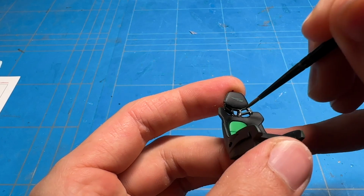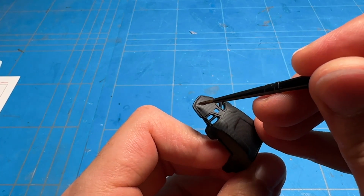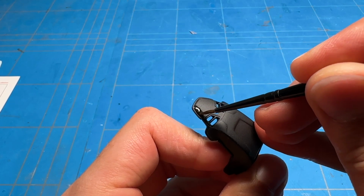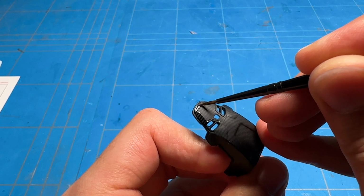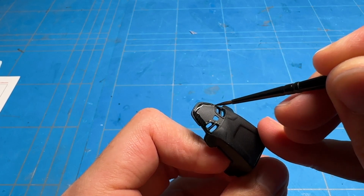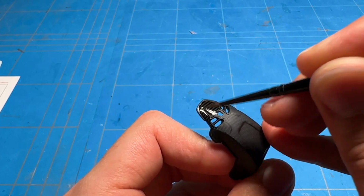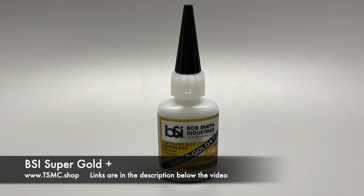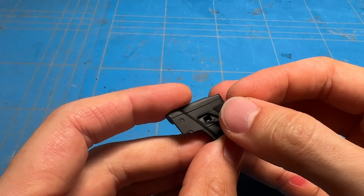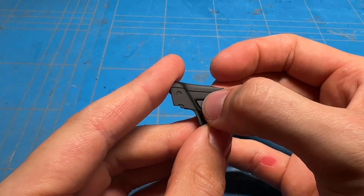The parts just need to be glossy, as they can't really be seen up close anyway, and with a brush and some 2K clear you can achieve quite a nice finish as long as you have a lot of clear on there and apply it in a nice thick coat. Most of the brush strokes on these smaller parts are not even there. On some of the bigger pieces they are, but I can live with that, as the back of the seat and the carbon fiber areas are mainly the biggest areas that needed the clear coat applied to it,